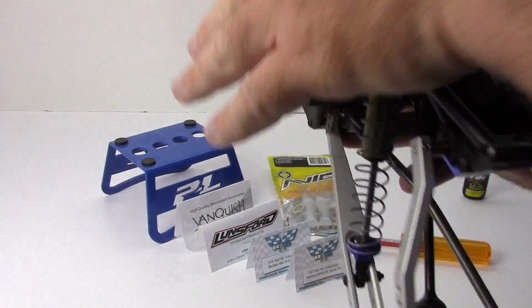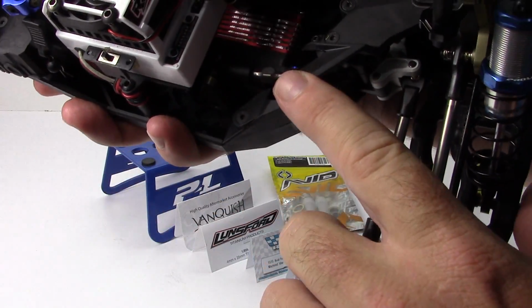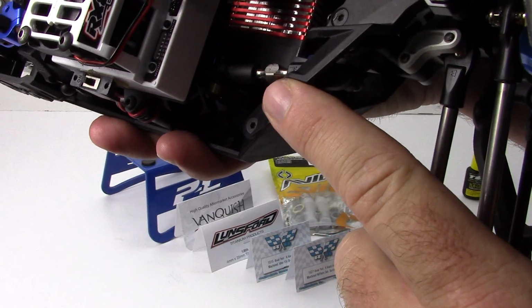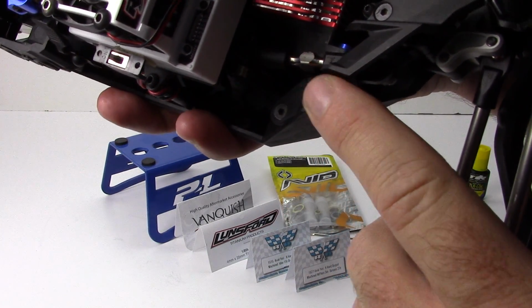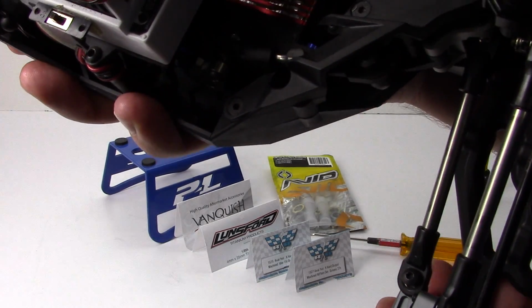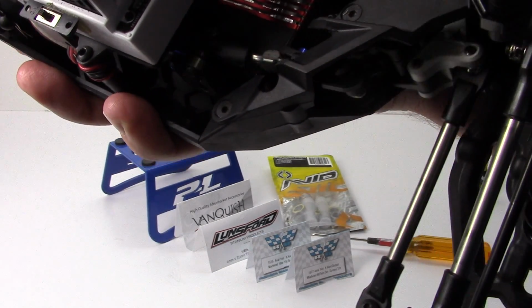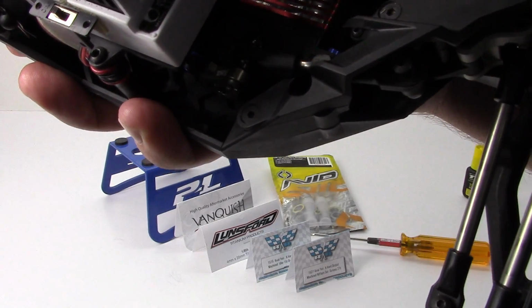Now on the flip side over here on that titanium servo, or the steering link right there, it's hard to see here with the lighting, but you can definitely see I've had to trim away that top plate quite a bit, but I have full throw now on my steering with that huge 4mm turnbuckle. So very nice added item.